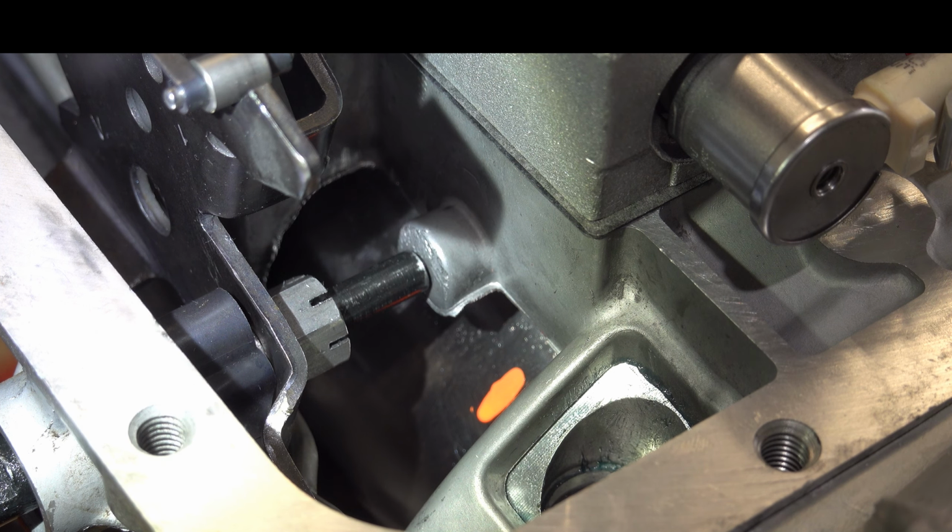All right, so now you have the outboard half of the assembly. So this is going to be your 4th gear apply piston. As you can see, we already have a spacer ring, or a shim, installed to adjust our servo travel. That's not enough. And then of course you have your O-ring. Now if you follow this method and you don't cut or damage the O-ring, then you can put it back in. I mean, you can reuse it as long as it's otherwise in good shape.